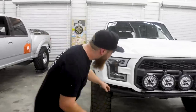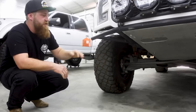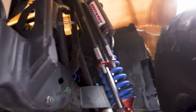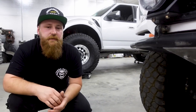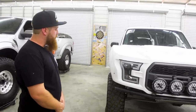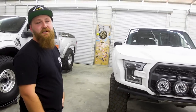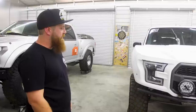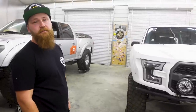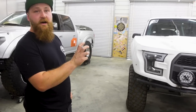Tell us about this front end — this is no longer the solo kit. We've got an Ocho Fab fabricated beam, so it's still a Dana 44, which is what came on the truck. It's extended four and a half inches, and Andrew there at Ocho Fab makes some super cool stuff. This is all fabricated, where in previous times the beams were cut and extended. I'm getting new beams from Andrew that, rather than ball joints, are going to have uniballs on the ends, and we're fabricating knuckles, big brakes. Sandy Cone makes four-wheel drive locking race hubs, which is pretty trick.